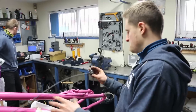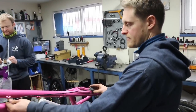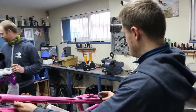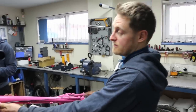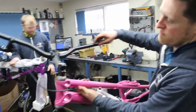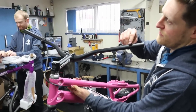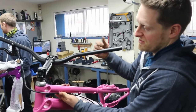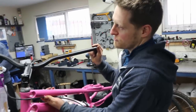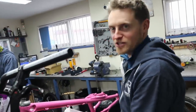Just checking it's all going to be good to go when it's bled up. The hose is probably a little bit short — possibly from the longer stem or just cut a bit short at some point in its life. Ideally you really want to be able to spin the bars 360° without it snagging, because if you've binned the bike and the bars just spin around, that would be game over. So we'll add a bit of hose to make sure you're not going to lose a five in a section because of a broken hose.